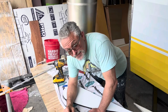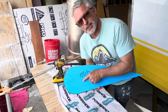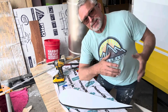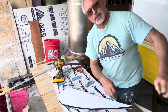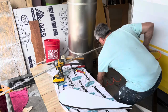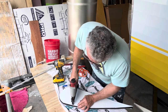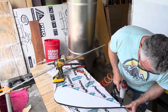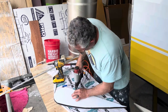I pulled the blue coating off of this side — this is going to be the side that goes against the trailer. I left it on the outside so I know which way to put the trim; sometimes it gets confusing. So I know this side is going out. I can put some staples in here just like you really would on your skin before you put the J-rail on. I'll hit this a few times.